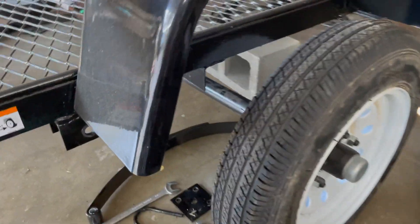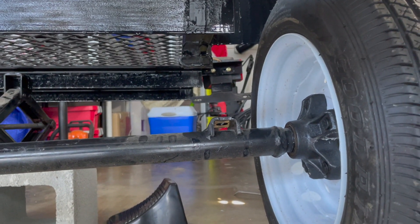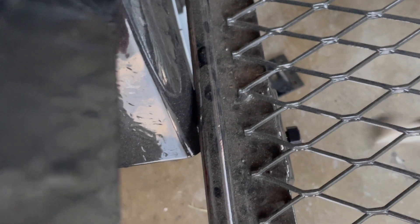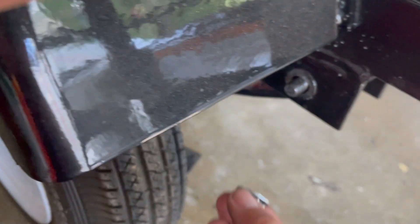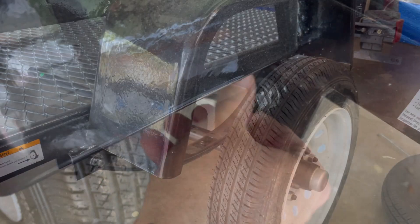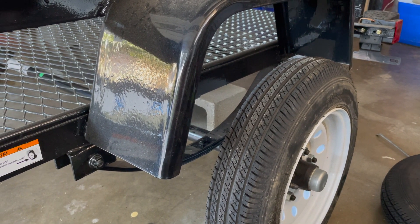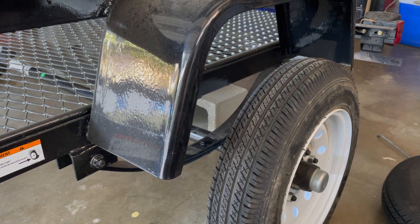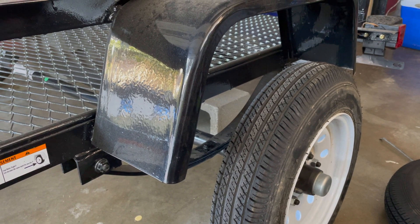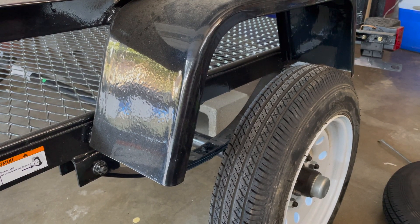As you can see, there's nothing holding the axle now. What we're going to do is take that leaf spring, put it back up under there, and connect the axle back up. Flipping the axle has really jacked up the trailer — in fact, I need to raise the trailer a bit to get the axle to fit back on. That's actually an advantage so I can precisely fit it without having to lift the axle as much.